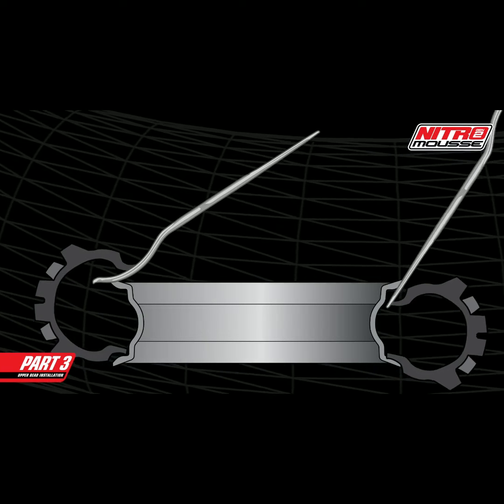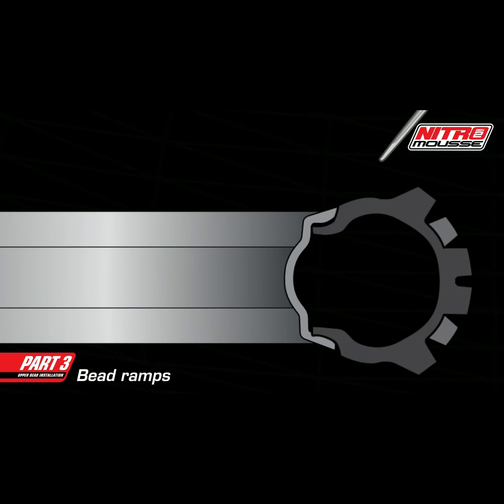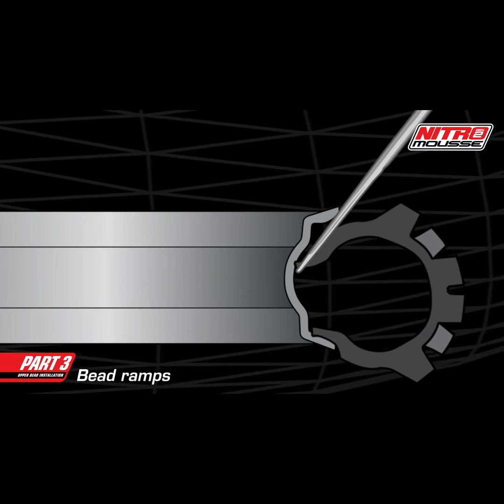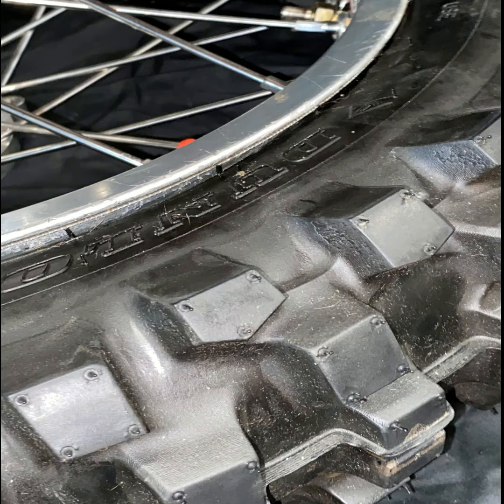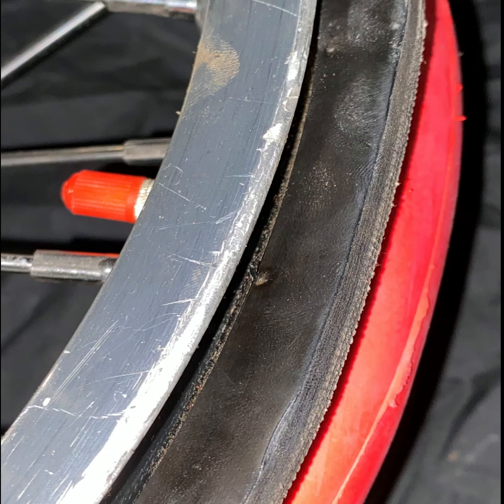The second is when installing the tire. As you put the last bit over the rim, the opposite side of the tire needs to be able to dip down into the drop center of the rim to create enough slack for you to install the tire without breaking the bead. As the tire sucks down into the drop center of the rim, it will put a lot of pressure on anything that's in its way. And if that's the valve for the high pressure bladder, it will try to tear the stem from the tube — at a very minimum, it will stress it, which can cause a failure later on.